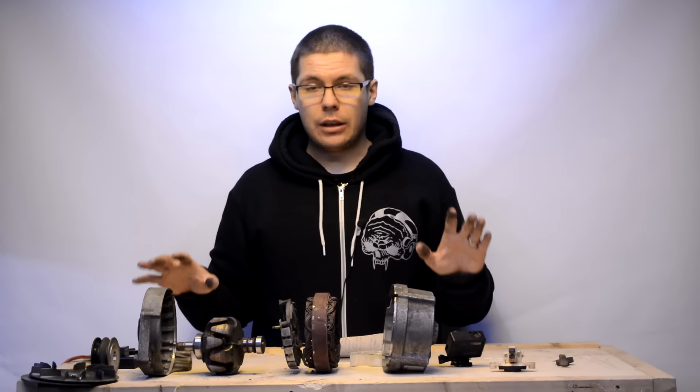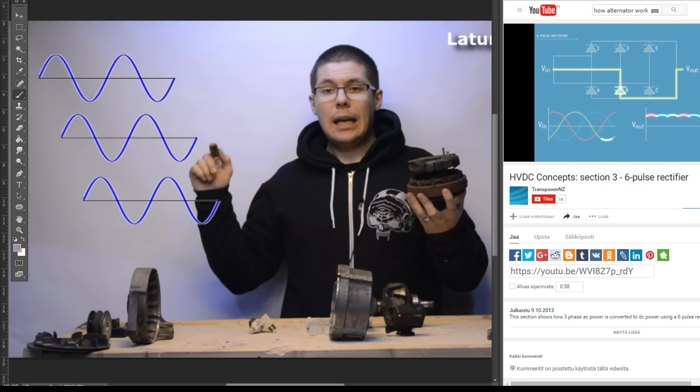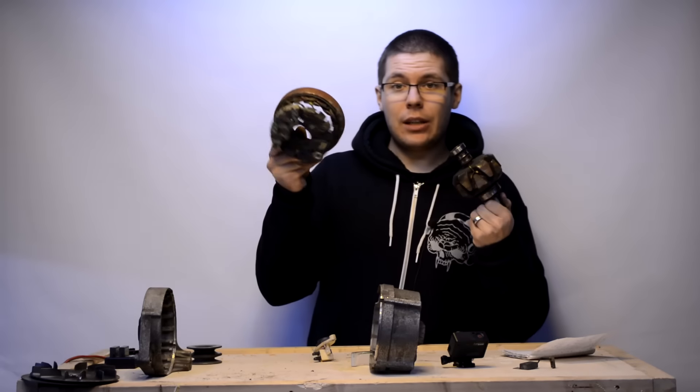I made a mistake in how I explained how the diode rectifier works. Here is a short video — shoutout to Transpower and Zeta who made this video. We can see all three phases of electricity that the stator produces going into the diode rectifier. The first plus-side output goes through the diodes and produces the highest peak, the negative sides also get rectified to produce a positive side, and when you have three phases 120 degrees offset from each other and use a diode rectifier to turn the negative side up and line them correctly, you get a very straight and stable DC current coming out from your alternator.